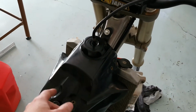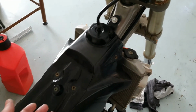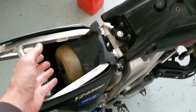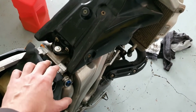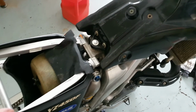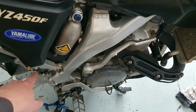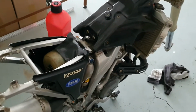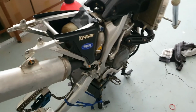Fuel tank I've covered. The filter was amazingly clean, so no dust, nothing, which really surprised me. You may see shiny bolts everywhere. That's because I have, wherever possible, replaced if required. The air filter is still the one that came with the bike, but it's properly oiled. Let's not forget, to get to the shock, you have to remove all of this. Wherever you see the orange marks, that's where I torqued everything to spec. And God bless the Japanese. The repair manual is freely available online, and it covers from 2005 to 2013. So, good enough.